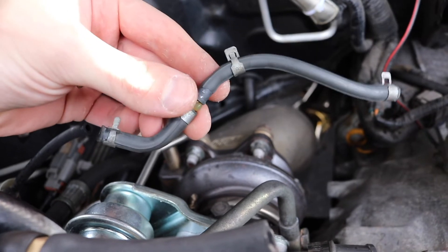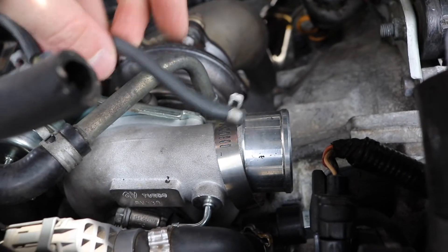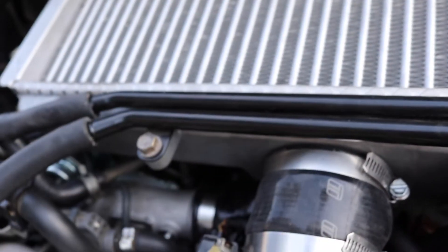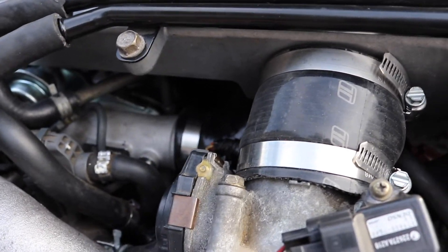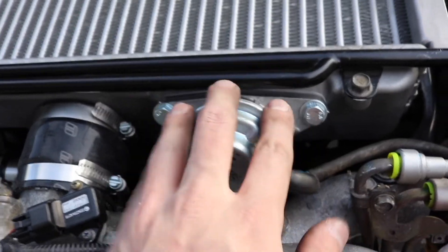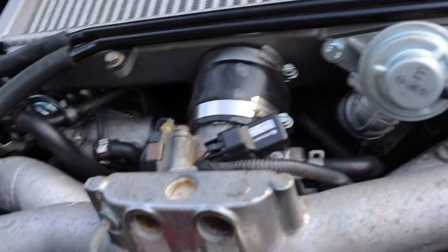Now that I have the pill bored out and back into place, it shouldn't be as much of a restriction. I hook up the small hose right up here and the longer one with the restrictor goes on the turbo, put the clamps back, and we're good. Once the vacuum lines are back in and the PCV valve is installed, you can put the intercooler back on — which is of course a pain if you've watched my other video. All the lines are hooked up, the brace is back, bypass valve and vacuum lines all connected, everything nice and tight. Now you can start up your car.